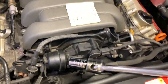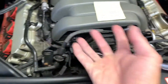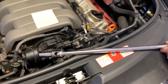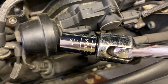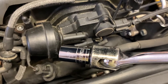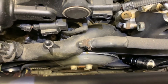First you're going to want to take the little cover here that has the Audi rings on it off. There are mount points here and there — it just pulls up. Then you'll want to get a fairly large tool; in this case we used a half-inch breaker bar with a 17 millimeter socket. Once you take this off, you can actually see the whole belt assembly and all the various pulleys.